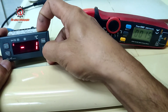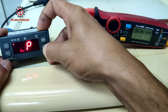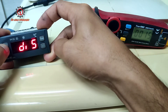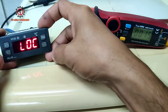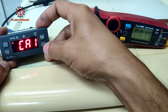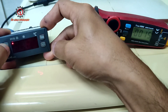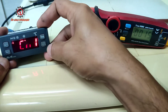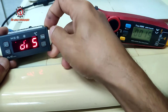So to do that, let's press and hold the button until CP appears, then release. Let's locate the display folder and press Set, then locate CA1 and press Set. We're going to add six degrees Celsius here, then press Set and press Function to skip.